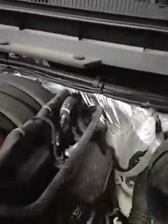And then I ran that down underneath the hinge there, right down here. You can see it or not. I zip tied the harness to the existing harness that's back there against the firewall, over towards where the battery is, and it's hooked up positive and negative to the battery. For the relay, there was already a hole in this fender, so I just bolted the relay right there, right on the bottom, and then zip tied it up, prettied up.